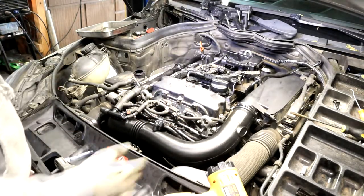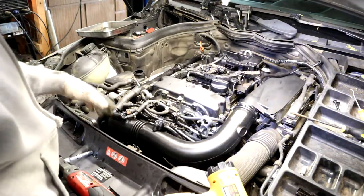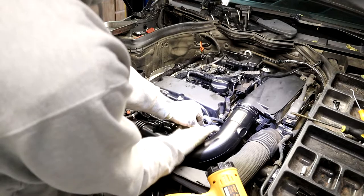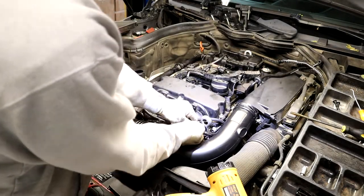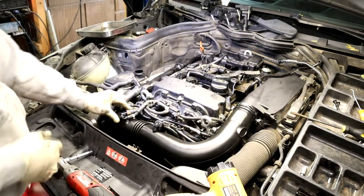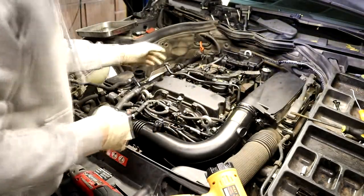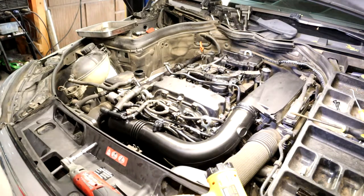Cool. And I'm gonna throw the coils in, and then the heat trick works on all these pipes, because they're all a pain in the butt. This thing does not just want to stay on here. It's right there. That's all now. Yeah, fill up your power steering first. And don't forget your coolant, oil if you drained it, and that's pretty much it.